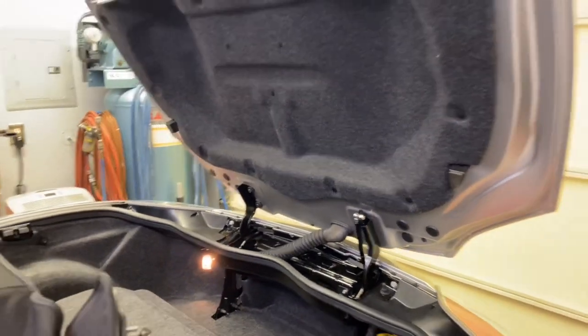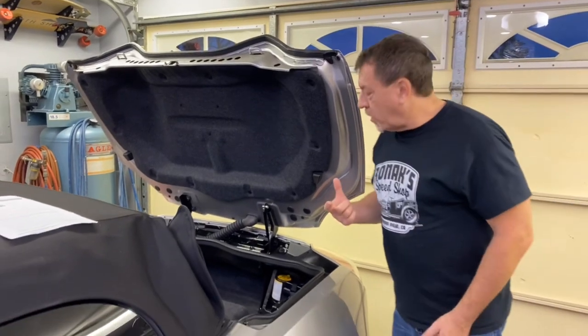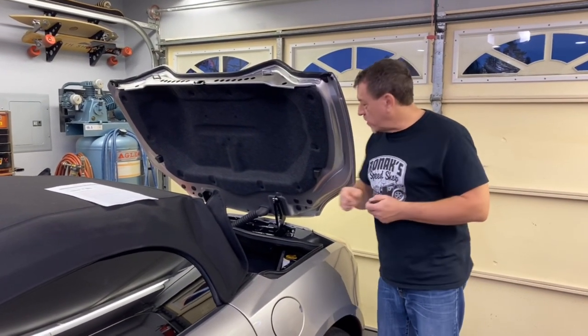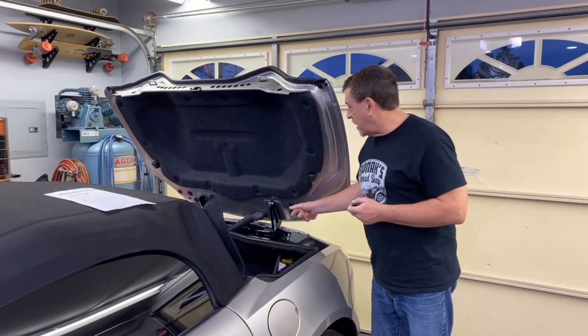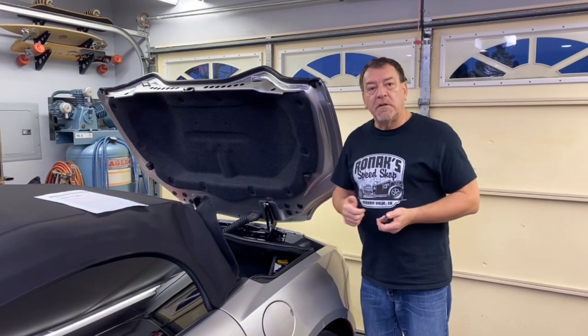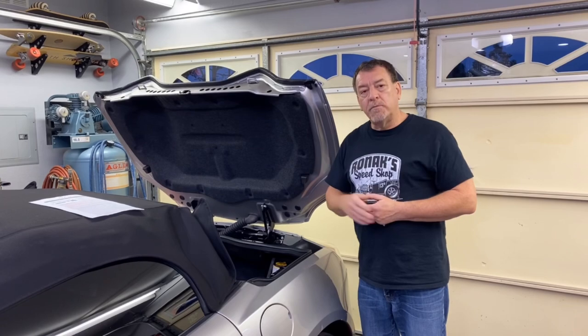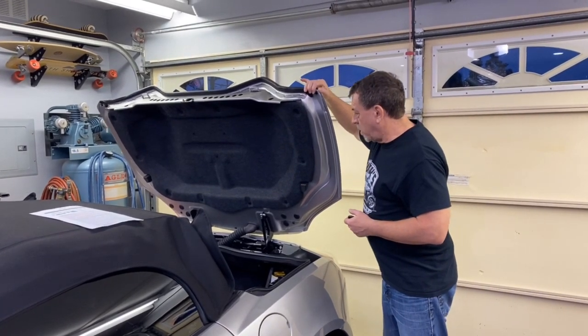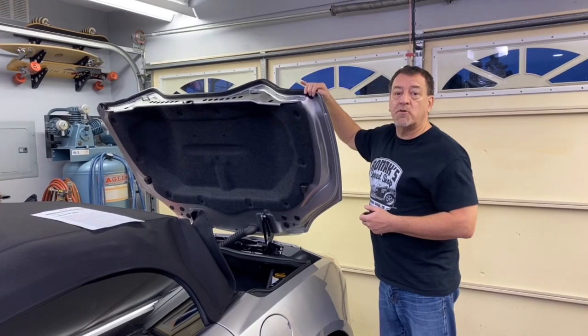For those of you having difficulty — rather than putting on that little spring that people are buying at hardware stores and wrapping around the hinge to help pull and lift the lid open — one of the problems is it swings the lid open a little too hard, and when it pulls too hard it'll spring the hinge and cause the trunk to come out of alignment.